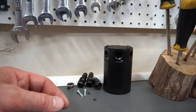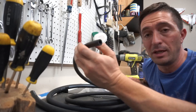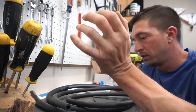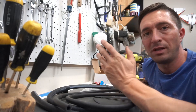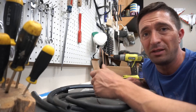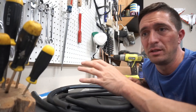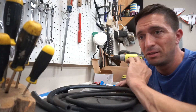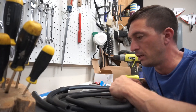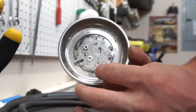Let's look at all the tools and extra parts you're going to need for this install. You'll need 3/8 inch hose — something durable, braided, and resistant to chemicals and heat. You don't want to use that plastic polyethylene stuff that a lot of these kits come with, because underhood temperatures are too much for that material and they'll just turn brown over time.